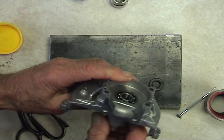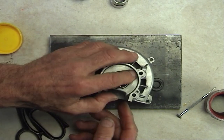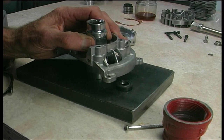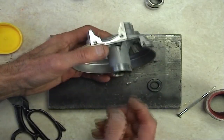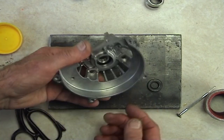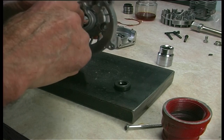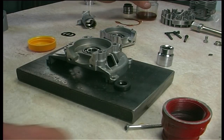Let's have a quick check — it looks like it's right in. Just give it another couple of final taps to make sure. Smooth, beautiful. The seal will go in here; we'll put the seal in after we've fitted the crankshaft. Just a dribble of oil — just a drop there and a drop there, that's all it needs. Spin it round and round. Basically that's your bearings in without any blood, sweat, or tears.